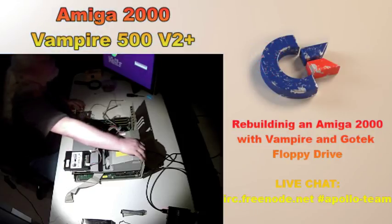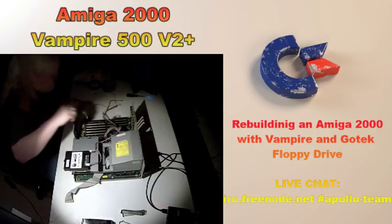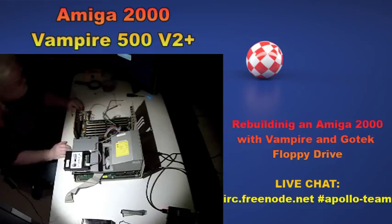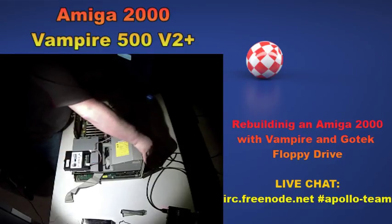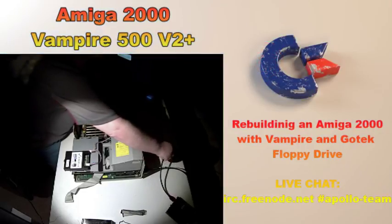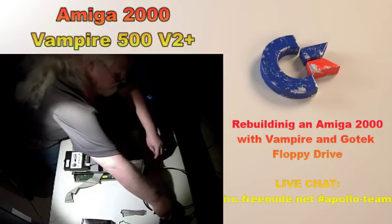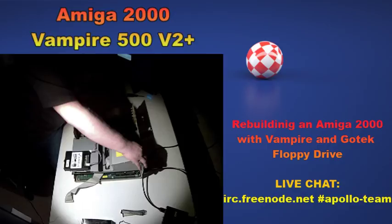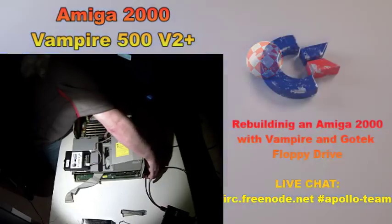Let's go ahead and disconnect the power supply. Now what I typically do, this is just me personally, and I know you guys out there probably already know what you're doing, is disconnect the power and then flip the switch back on the power supply, just in the hopes of discharging capacitors if possible. Only because I'm the type of person that will bump into pins or somehow short something out inadvertently, and I might as well be as careful as I possibly can.